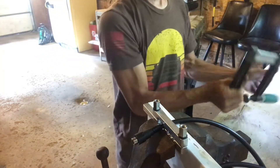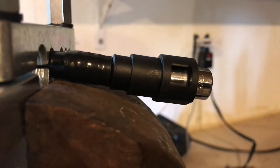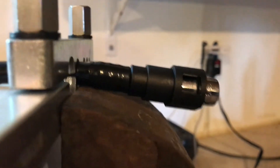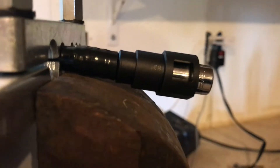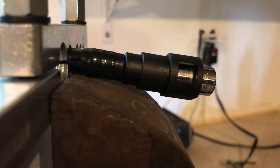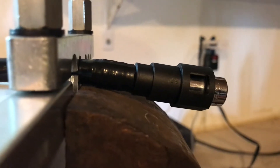And that's where I'm going to quit there. Here's the finished product — heating it up worked pretty good, made it a lot easier to slip on. That's the way they recommend doing it anyway: either put it in boiling water or use a hair dryer like I did. I probably only had it on there 15 seconds, so it doesn't take much. You want to make sure it gets pretty pliable, but don't get it too hot — it'll just kink and bend and you won't be happy.